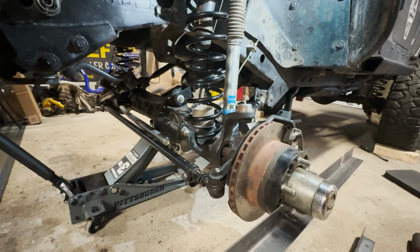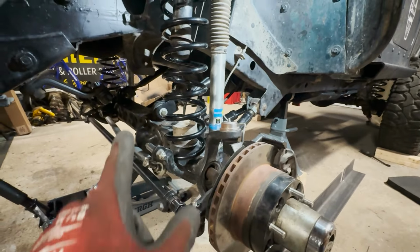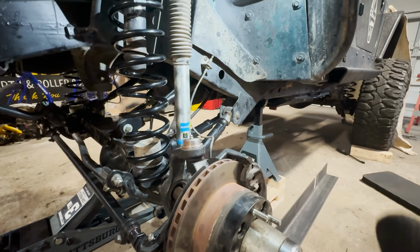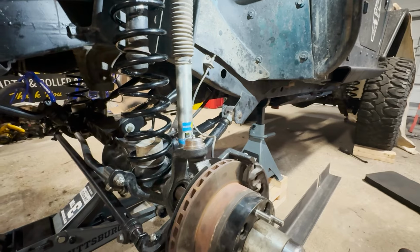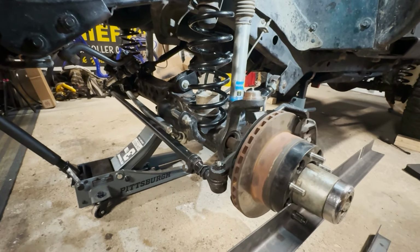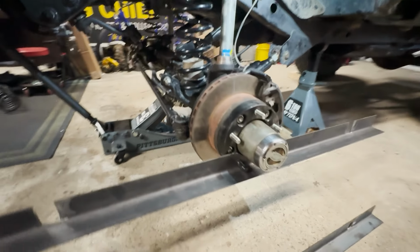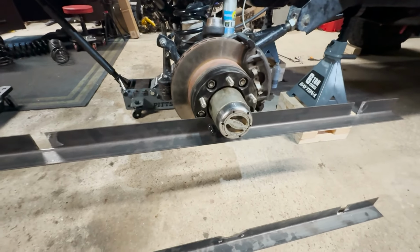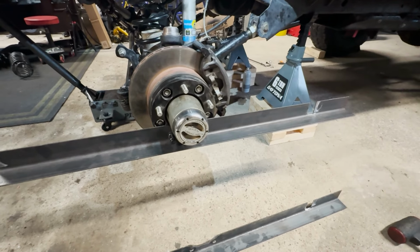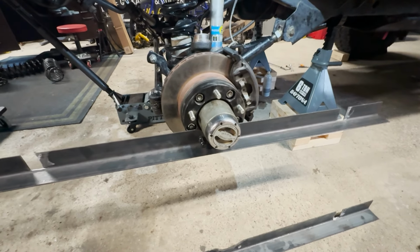Then the next thing I need to do, I also greased everything too. Grease point up on that control arm, and grease the rest of the joints over there. But the next thing I need to do is set an alignment. Set the toe on this. So, there's a couple of ways you can go about that. You can do it right off the tires, but that leaves a lot of margin for error, just between the tire manufacturer and pressure and...